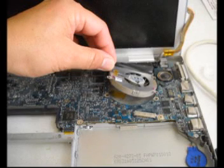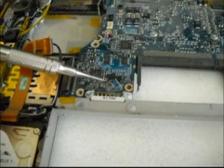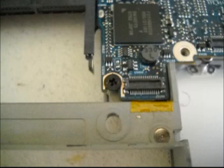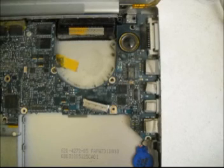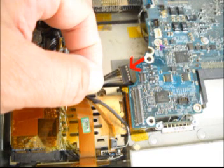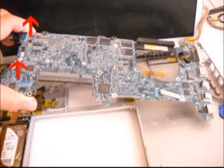Now you also have to remove the fans as well as the CMOS battery. That's the left fan. That connector is for the battery, so you also have to remove that. Just somewhere underneath is the PCMCIA connector or terminal — I think that's also an anchor screw for the motherboard, you also have to remove that. Just underneath the PCMCIA is the power inlet. That's the harness that goes to the power inlet, so you also have to remove it, but carefully, because you might break the terminal. That's the CMOS battery connector — take it out.